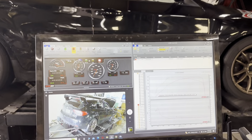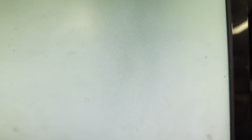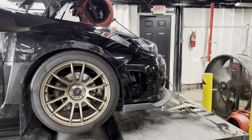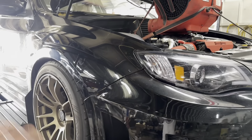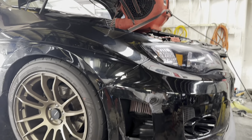Car held together great but I definitely need to get the ignition coils — you saw that little dip. Once we fix the ignition coils, and I'm probably going to do the one-step colder plugs, I'm pretty much guaranteed to gain another five horsepower from plugs and coils alone because it'll run better. Then I'll be at 345. From where we were last time to where we are today is a huge difference — definitely a heartwarming situation knowing this car is actually capable of it and it finally did it.